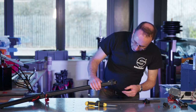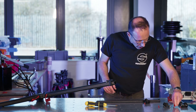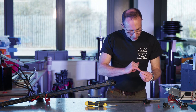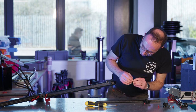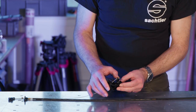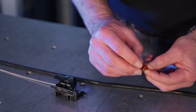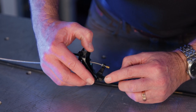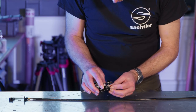To replace the lower brake pad, simply reach inside, grab hold of it, and pull it straight out. Get your new component — on the top of the brake pad there's a small feature which must locate above the feature on the brake lever. Inside you have the lower brake mechanism, and you need to make sure that this little ledge on the lower brake shoe locates above this part of the brake lever. It just clips on — it's very easy, but it's important to get it in the right place.